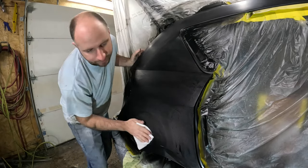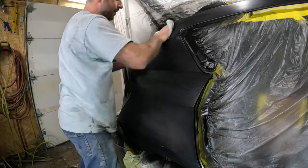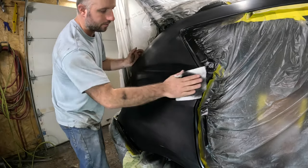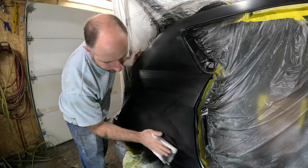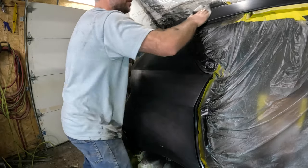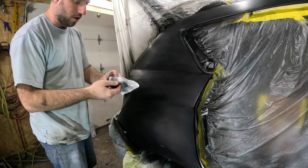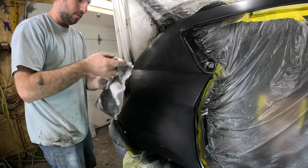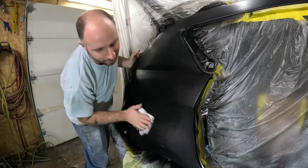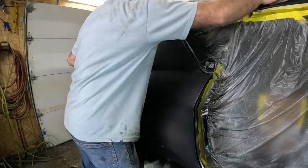But I would recommend just regular water. Technically, you can use a tack cloth on this, but you're gonna ruin a nice tack cloth getting all this dust on it that you just got from all the sanding we just did with the 1200. So it works just as good just getting a nice brand new uncontaminated paper towel and just wiping all that dust off of it, just wiping it off nice,